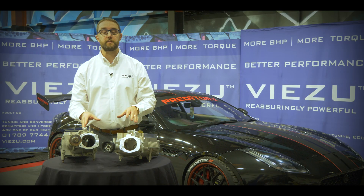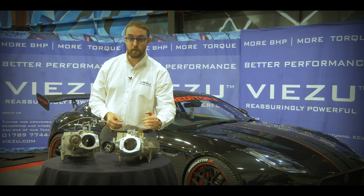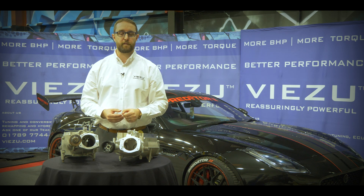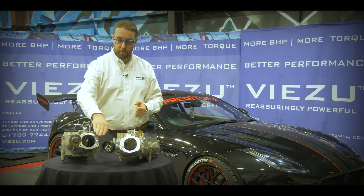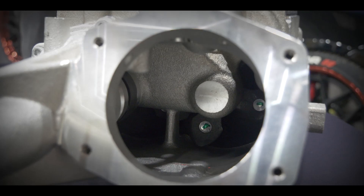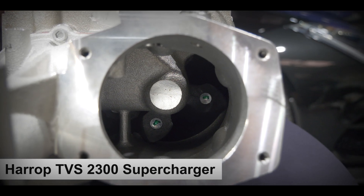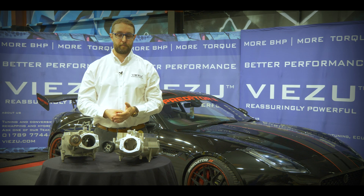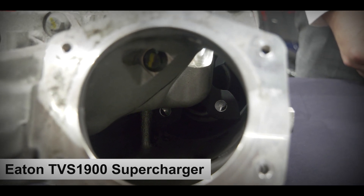In terms of machining and CNC work, there are differences in how the air flows through here. Bear in mind we have a bigger, longer gear set in the Harrop, so it may look like there's less airflow initially, but the additional airflow required for the bypass has been machined just under the lip at the top of the Supercharger. Moving to the front where the throttle mounts, you'll see a smoother, higher flow rate for the air — less interference, less casting getting in the way. We can see through more easily to the gear set, with less material blocking the air path, helping improve flow rate and reduce friction and heat build-up. On the standard one, there's a lot of excess casting — it does a fantastic job, but it is nowhere near as optimized as the flow rate on the Harrop TVS 2300.